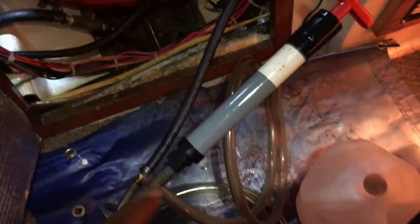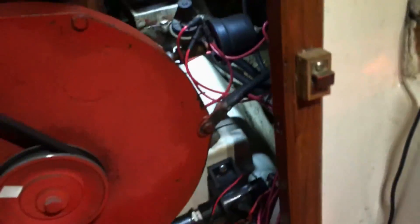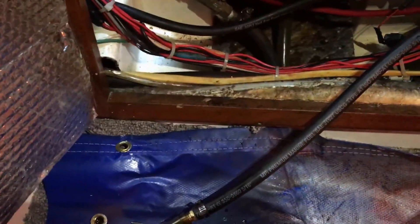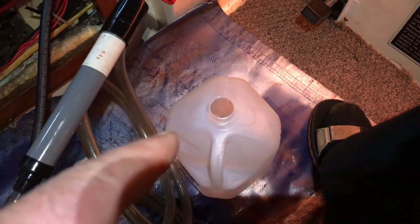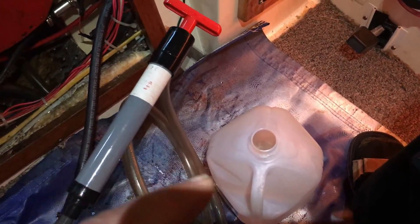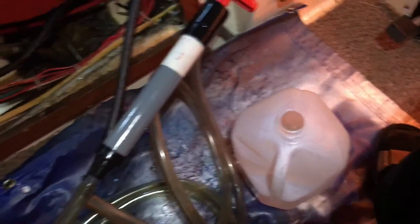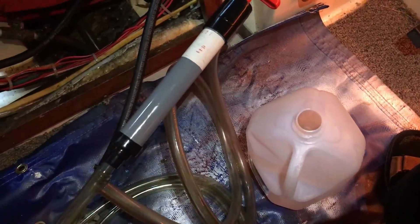Here's step number two. I've got a little hand pump with a tube that comes out the bottom. It goes to an engine oil drain tube here, back to the bottom of the oil pan. Some people suck the oil out of the dipstick, but that's really hard to do on this boat. There was a kit I bought — it puts a long metal tube down a spot on the side of the oil pan on these Atomic Four engines, and that allows you to get a hose out here. I hooked it up to the hand pump and pump it into a gallon-sized jug that contained distilled water — the same water I used in dispensers for the battery, so it serves a dual purpose.